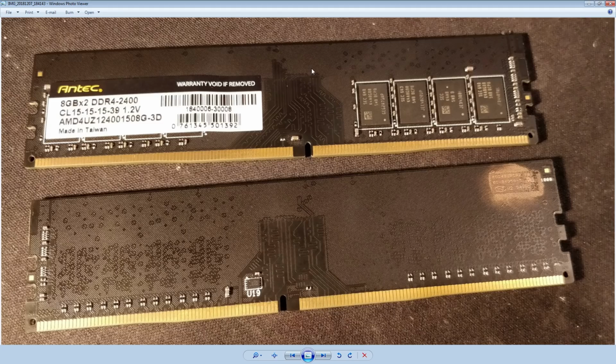The logic I can see in that is that when Samsung bins their memory kits, the BCPB identifier doesn't really tell you that the kit is not capable of 3200 CL14 or 3600 CL17 or whatever. It's not like, oh, it's labeled BCPB, so it's never going to go above 2133. It's just what Samsung wants to sell it as. Samsung also has a bin that's 3200 megahertz at like CL22, so that's not exactly a great bin either. So as far as I can tell, the binning identifier doesn't seem to have a whole lot of value. But don't quote me on that.